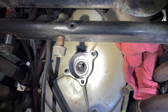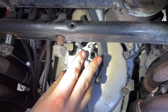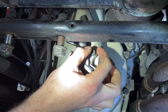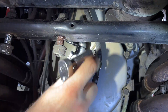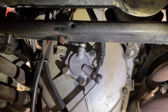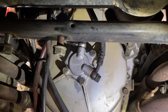Install is reverse. I like to put that rod on there first before going back in. Don't bolt it down up top yet — just leave it loose. Push that bad boy back in there. There's no gasket or silicone; don't do any of that — just put it in there nice and dry. You can put some grease on that center seal for the rod. I always replace banjo bolt crush washers — they're like three or four bucks per washer, expensive but replace them because you don't want it to leak again. There would be four total for the top bleeder and the banjo bolt. Don't over-tighten the banjo bolt — there is a torque spec; I'll put it in the description, but tighten it until it seats and then give it a nice half turn.